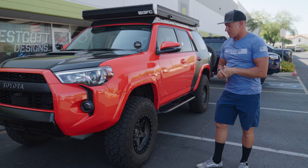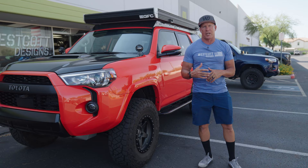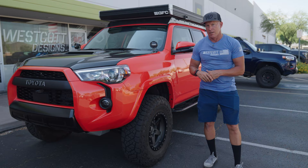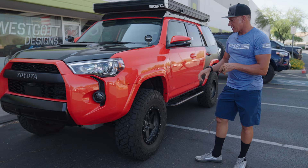This is a negative 10 offset, 17 by 8.5. This has our new lift kit in it, which will be on the website soon — people have been asking when it's going to be available. This lift kit is basically our 2-inch. It already has 1-inch from the factory with the TRD Pro lift, and we added another full 2 inches. Our other lift on the website is between 1.6 and 1.7 depending on measurements. This lift works really well with a little more clearancing, and we're able to run a 285/75/17 on this setup.